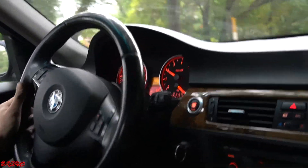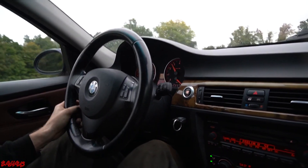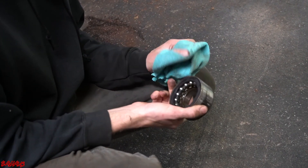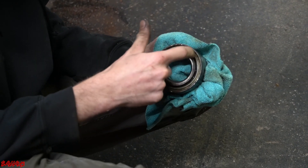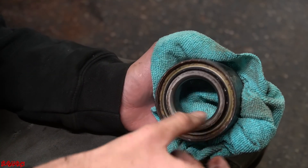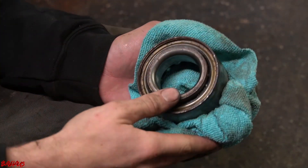So if you're having ABS issues that can't be solved easily, be sure to check the back of those wheel bearings. In our case, our pickup was completely missing — yours just might need to be cleaned, but that's just a quick tip. Here's the bearing we removed. On the back, you can see the pickup for the hall effect sensor is completely missing — the thing the sensor targets that spins and gives wheel speed is just not there. That's what our issue was, and now it's solved.